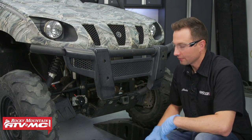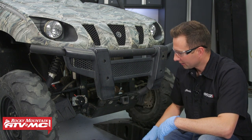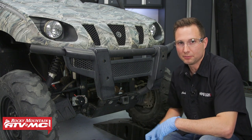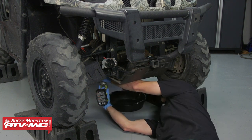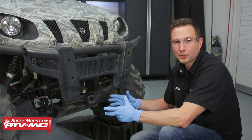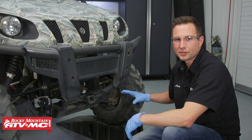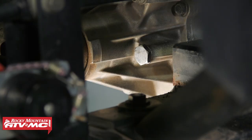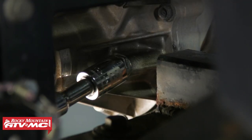We're at the front of the machine. We're gonna start with the front differential — the drain plug and fill plug are gonna be on the passenger side. Now, you don't have to remove the skid plate, but for us to better show the process, we're gonna remove it. We also supported the vehicle on some ramps — if you do raise your vehicle off the ground, make sure you do it in a secure and safe way. From here, we're gonna clean off our drain plugs, remove the fill plug first, and then the drain plug.